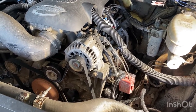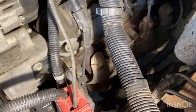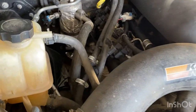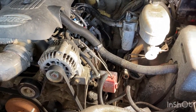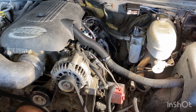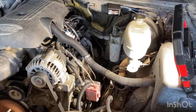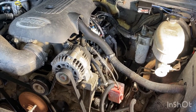I did mention before that I was already missing a few bolts. Right down there - that one's missing, the one in the very back is missing, and the one in the very back on the passenger side is missing as well. I'll either get some channel locks and back those out, or get my Harbor Freight flux core welder out and try to remove the studs. They have to come out - it'd be one major exhaust leak if I didn't. I'm going to try to break these free and I'll bring you all along.